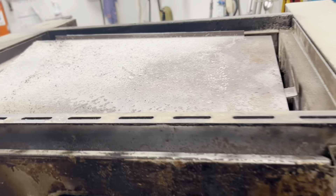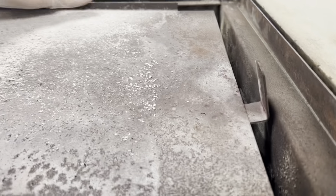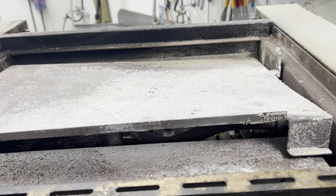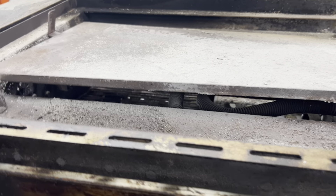This is where stores screw it up — this heat shield is on backwards, so this is never going to function right. This heat shield has to angle towards the front. See that catch right there? It goes there so it angles out the front. If you put it backwards it's never going to operate properly, because you're not having the heat escape how it's supposed to and get fresh oxygen where it needs it.